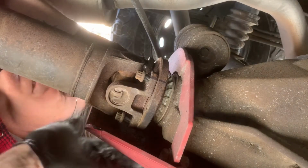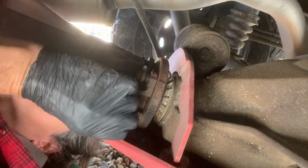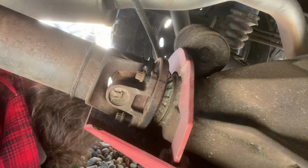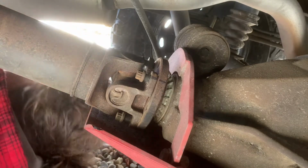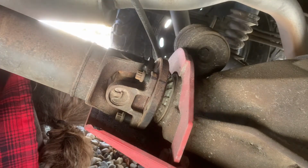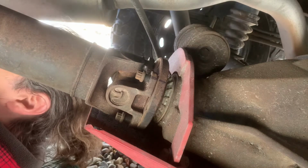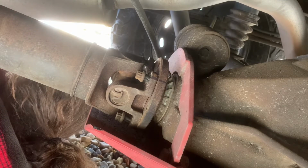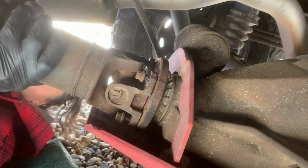With the rear diff skid plate, you do have to rotate the bottom two up here because you will not get a wrench on it without one. You don't need to do that at all. So that's a little extra step in here, is that once you get two of these secured, I think it was an M12. Yes. It's an M12 that I used to break this free, and it did require some force.